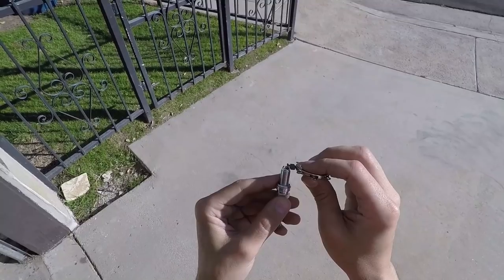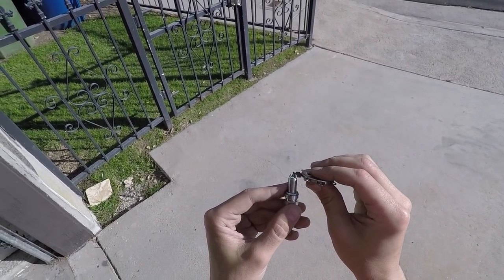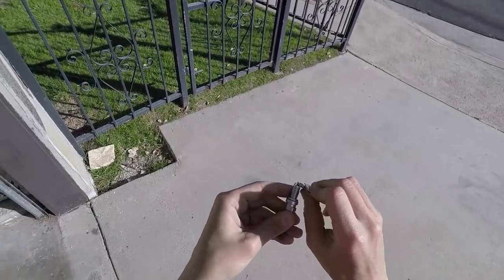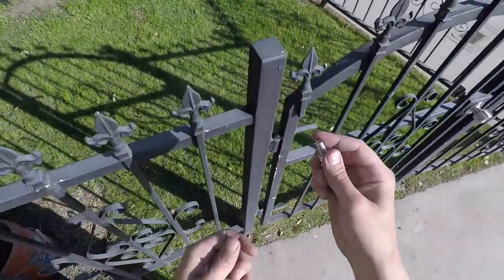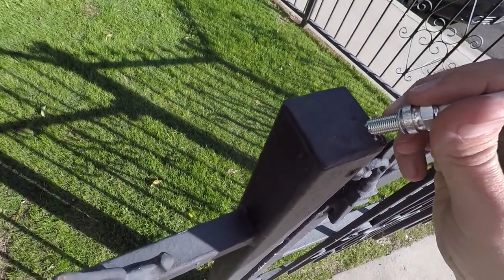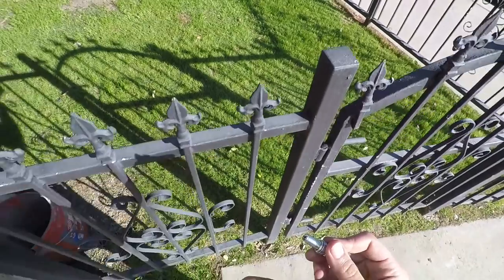Generally, as a rule of thumb, I like to only use this gauge tool to loosen or open the gap. To close the gap, generally what I do is I just tap the outer electrode on a flat surface. Just gently tap it. And that'll knock off a thou or two.